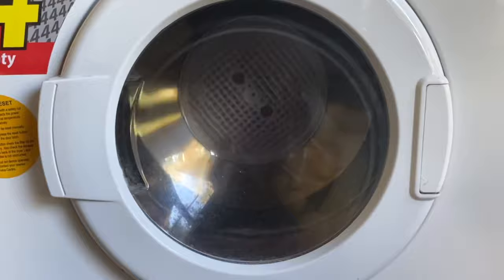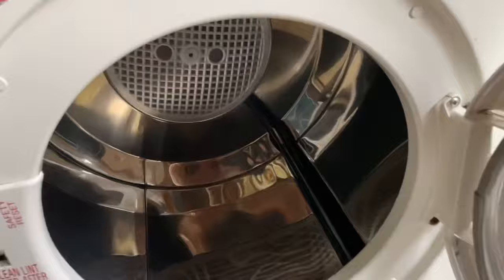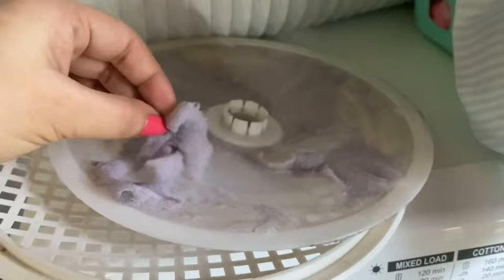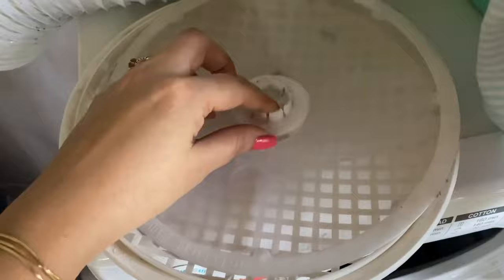Once you can see that your clothes are completely dry, take them out. Now I'm going to show you the dust — how much dust we have in our clothes. Once it is completely dried, take out the clothes, then remove this filter and see how much dust is there. Generally this is less; when we wash blankets or heavier items, a lot more dust comes out. You have to clean the filter thoroughly every time and then fix it back in.